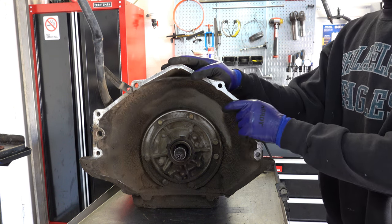If you're gonna build a lot of transmissions, you definitely want a foot press. They're just a lot more efficient versus bench vise mounted units or individual compressor tools that fit into a toolbox. They make quick work of these return springs. Some transmissions have assemblies where the spring is significantly large enough or high tension that you're going to want to use a press, but those are few and far between.